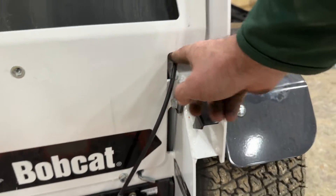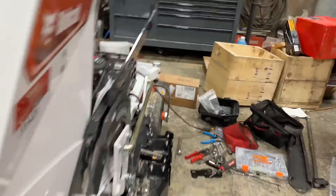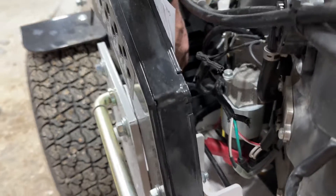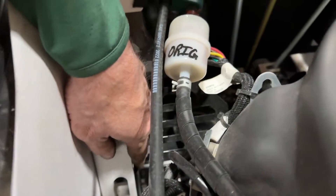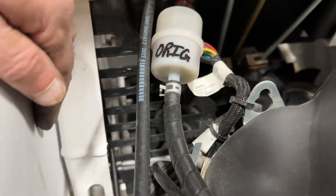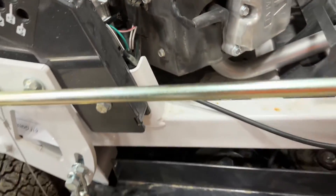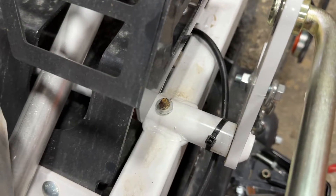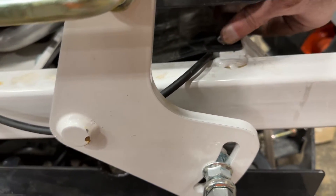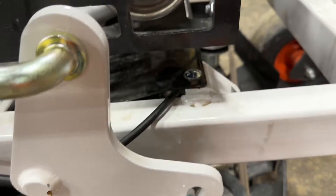The cable runs up along through here. As the gas tank comes over to this side and goes through down here, there's a vent in here. As that cable runs through here, we've got to keep it down low because it's going to run along here. Over past this deck lift, underneath it, zip-tied to that deck lift so it stays put. It tucks under. There's a heat shield for the muffler and then another cover for the belts. There's a little corner right here that you can tuck into, and it's going to come down and around.